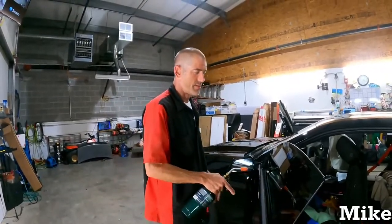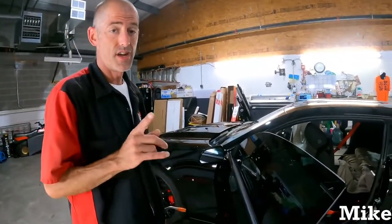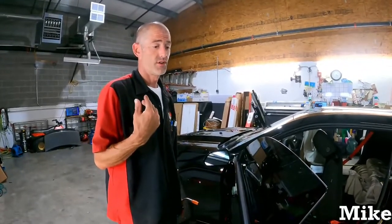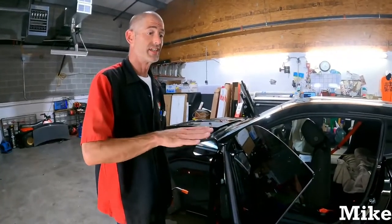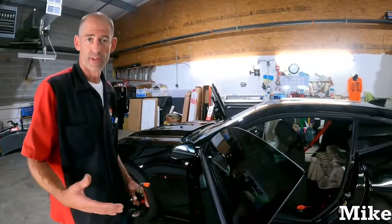Because when I first started filing windows, basically what happened was I wasn't heating it. And when I'm not heating the top edge, the tack to the glass, when I was filing it, it was coming off and a lot of garbage was getting in behind. So in order to not screw myself every time, this is what I do. If you're using a tool for the first time and it breaks or scratches film, the thing goes in the trash, we ain't using it no more. That's kind of the way I tint. If I did that process a few times and I was comfortable with it and it still screwed me, I'm not doing it no more. So this is statistically the best way for me. Yeah. Everybody does it differently.